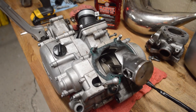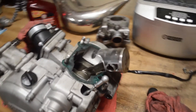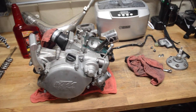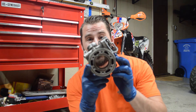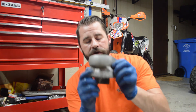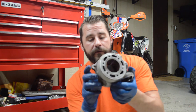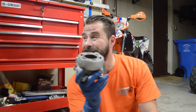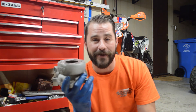So there you have it. We'll wait for UPS to bring us a new ring and piston and go ahead and slap that in, put it back together. We'll do another compression test — hopefully higher than 98, which is what we had. So what did we find? We have a jug that's really good, in great condition — that's a good thing. We don't want to replace this, it's several hundred dollars, and getting it honed means taking it to a machinist which takes weeks. We have a jug that we could use a type B piston in from Vertex — I like those. Everything seems to be in good working condition. I predict when putting a new piston in here, compression should be around 140 to 150 hopefully. Anything better than a hundred is good for me right now.